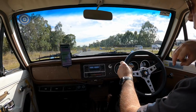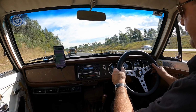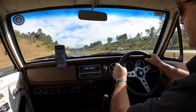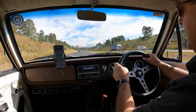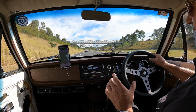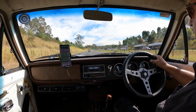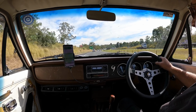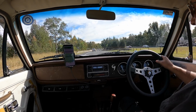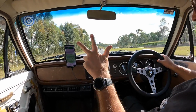As I was saying, we're going to need to put a limited slip diff in it. I figure that once we get the fuel injection on, and the quad throttle bodies and extractors and everything, and the cammed high compression A15 in it, it should be quite a fun little thing. I have beached it going up driveways on an angle a couple of times already, where it picks up the inside wheel and just dangles it in the air. Same problem we had with the Suzuki van. But yeah, so I'm thinking a Cusco RS. The problem with that is there's a 3-month wait for them.